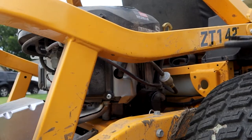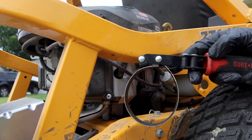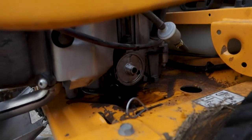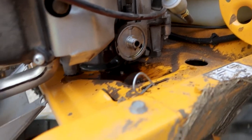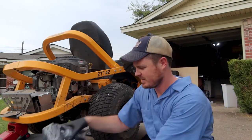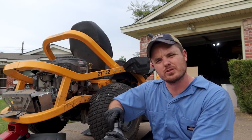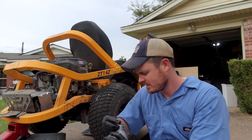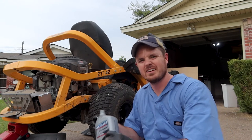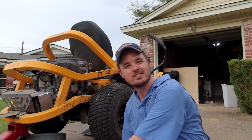There's your oil filter. Get a good oil filter wrench — I recommend one of these, not one of these. I forgot some oil is going to come out right there at the filter, so if you're like me, your driveway now has an oil stain. Congratulations. Now get your fresh filter out, get some of the oil, because you're going to want to dump a little bit in the fresh filter before you screw it in — approximately a dash. Just get some in there, then screw it back in.